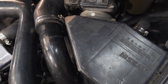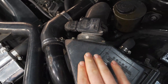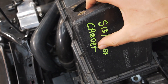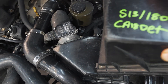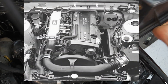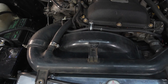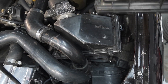So what I have here starting off is the airbox, and this one as you can see has the mass airflow sensor pointing on an angle back towards the engine. So this one is for the turbo car and it's also got this breather hose on the side. This one says CA18DET on it but it is in fact not a DET airbox — as you can see the mass airflow sensor actually points over the radiator shroud. The box sits flat like the other one but it actually points slightly forward, because the naturally aspirated engines just have a pipe which goes directly to the throttle body. The bottom of the airbox on the DE and the DET engines are the same, so they're interchangeable — you can switch between the two tops.